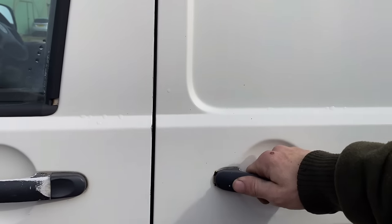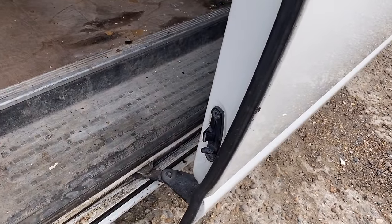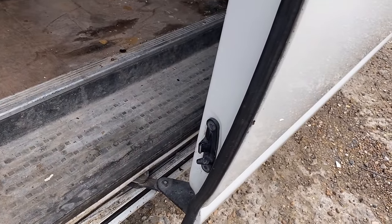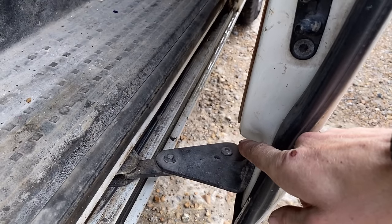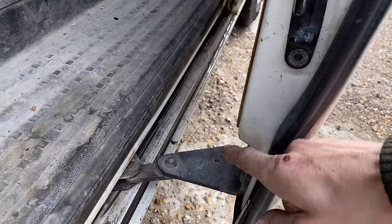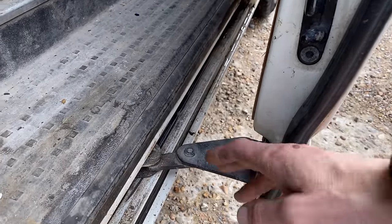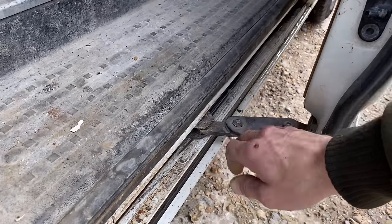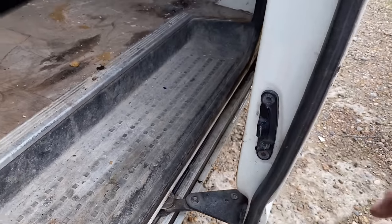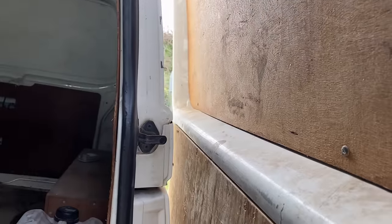One thing I want to point out — the roller on the bottom of the sliding door has dropped down; the bearings have fallen out. You can buy these rollers for about 15 quid on eBay and easily change them yourself. There are just two multi-spline bolts in there — you need someone to hold the door when you undo the bolts because the door's going to drop. Pull this part along, hold it at a skew angle, and it comes out. New one in, line up with the bolt holes, and that's it. There's one on the top and one along the back — you'd probably spend about 30 quid replacing all of them.